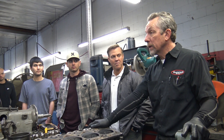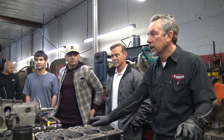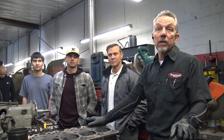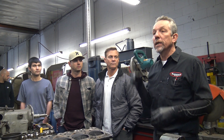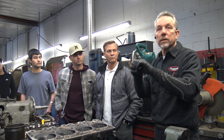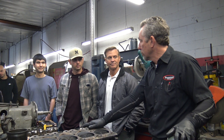From what I understand, Evans is about $35 a gallon, but it's a lifetime coolant — they say about 8 to 10 years before you need to change it. It's basically electrolysis that degrades it. I've also done this on a lot of pre-war cars — you use water-soluble oil. It's an oil you mix with water that doesn't separate, and it's used to cool machine cutting. You can put it in cooling systems. People freak out when somebody looks at it — 'oh man, your head gasket's out because the coolant's white.' No, that's water-soluble oil. It's a good trick.